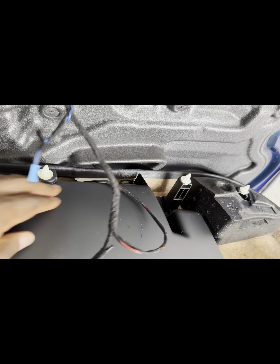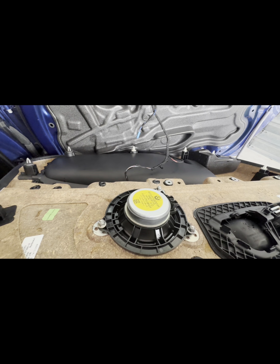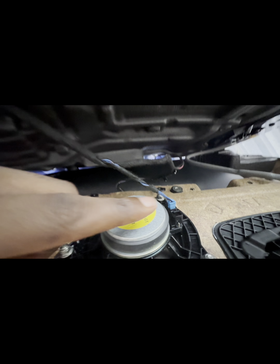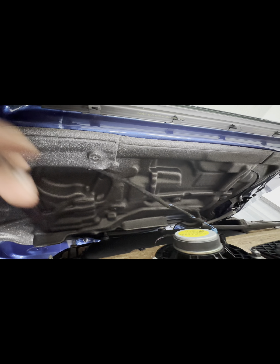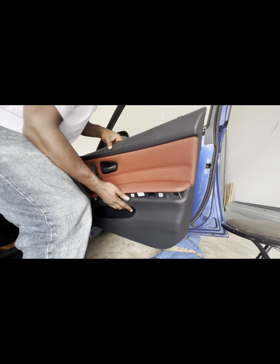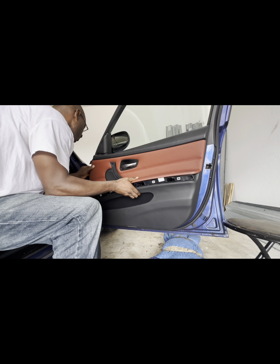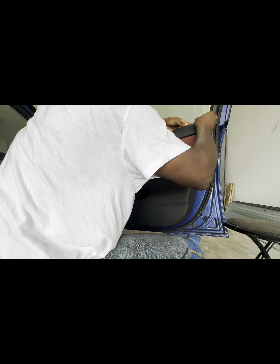Okay, it was my mistake — the black-and-yellow one goes on the bottom, this blue one attaches to the speaker — I believe it's the bottom one, not the top one. I'm gonna try it out before I put everything back together. I just turned the radio on and this works. The bottom one is for the speaker, I'm pretty sure the top one's for the tweeters. All right, so now we're gonna put everything back on — push the clips against the door, and hopefully everything should be sitting flush. Make sure this goes into this hole — there we go.